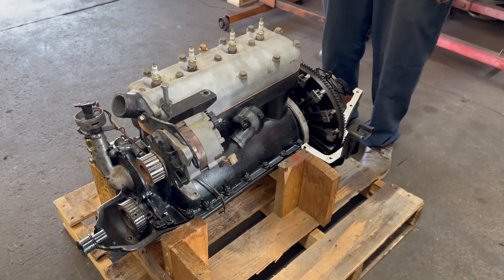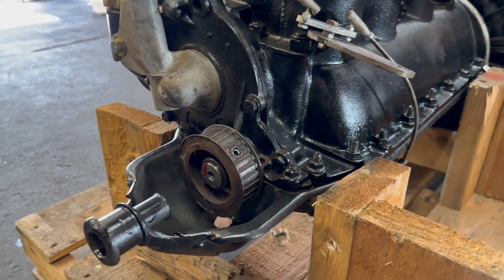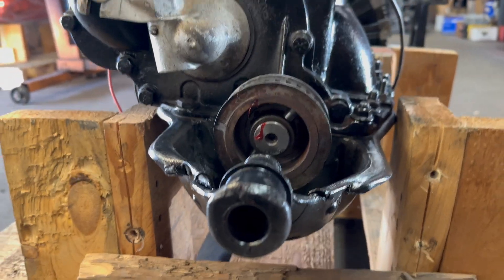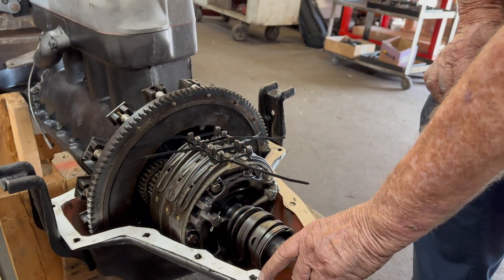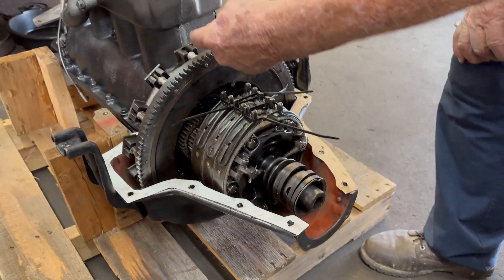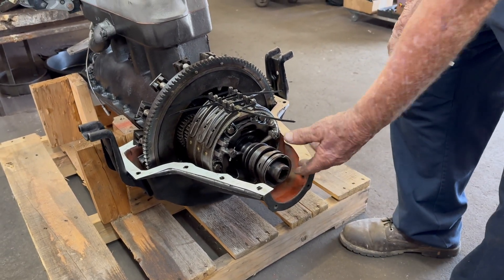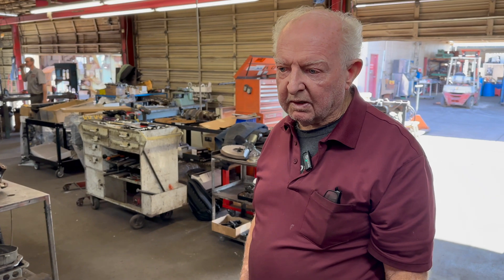We were talking about the idea of a spacer because you have that oversized crank. We just never put the spacer on it because nobody's ever explained to me why it would possibly work. When you look at this put together, that oil pan — which is very stout, it's one big piece — has a connection from the hand crank at the front of the crankshaft all the way through to the back. If you were to lower this pan down with a spacer under the block, this shaft here would not be center line to the pan. The pan would be down three quarters of an inch and the drive shaft would not go in the hole. They still make spacers and you can buy them, but I don't know how they work.